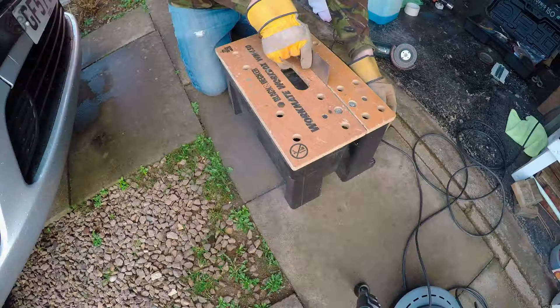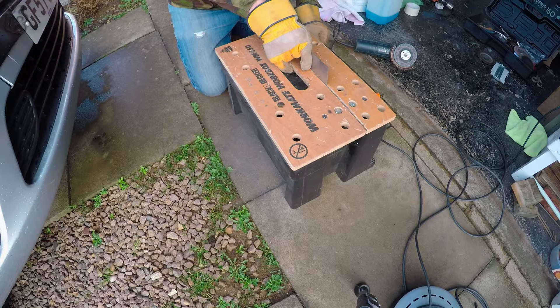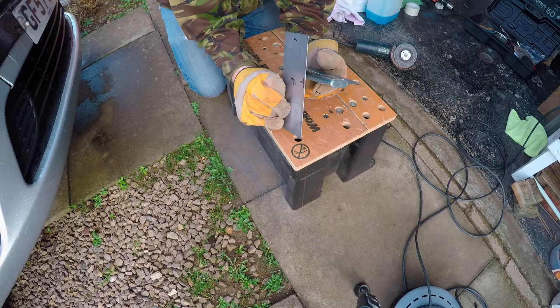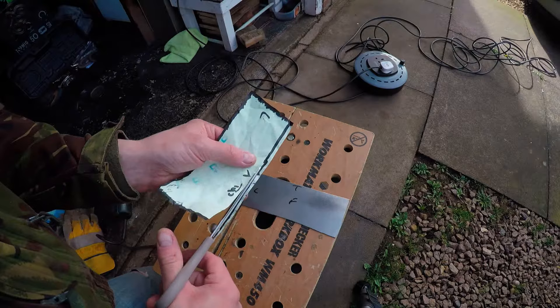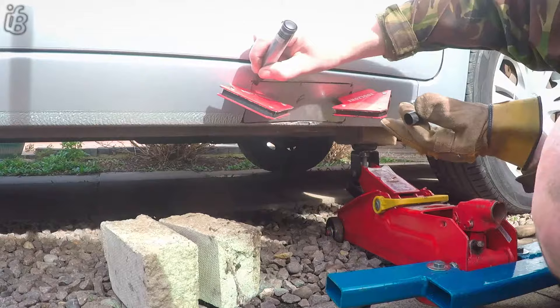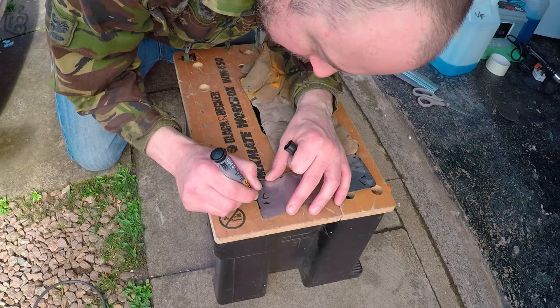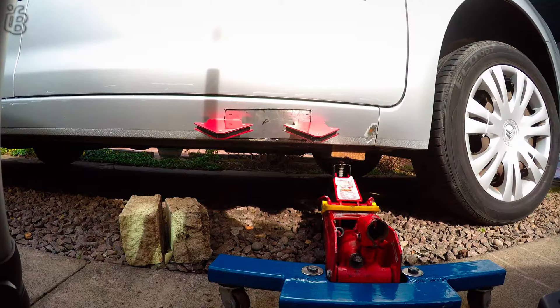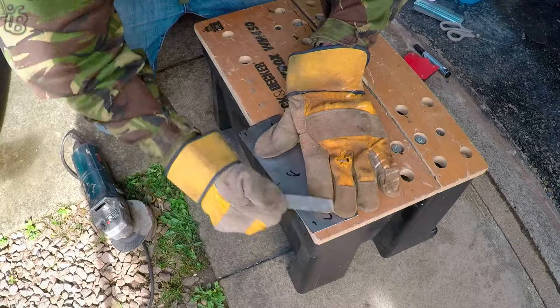And here I'm just going to be profiling it a little bit more — bending it over just very gently, lowering it a little bit more and bending it a little bit more and checking out on the profiler. I'm just cutting out the last bit. So I want kind of about the same gap as what the MIG wire is. The plate I was using is 1.2mm and the actual sill, I believe, was like 0.8mm.